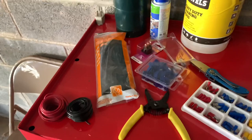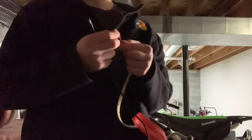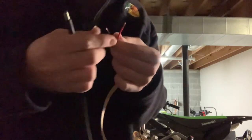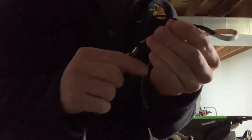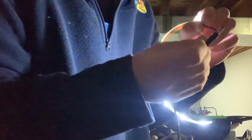I wanted to use a basic switch from O'Reilly's and wire it straight into the running lights on the truck. Before putting them all on, I'm going to test them first using a 12-volt charger for an electric motorcycle. I'll take the ground and red wire, stick the red inside the hole in the middle of the charger, touch the black wire to the outside, and make sure not to short it. Everything lights up — they're pretty bright and clear white. I'll set that one aside and test the rest.